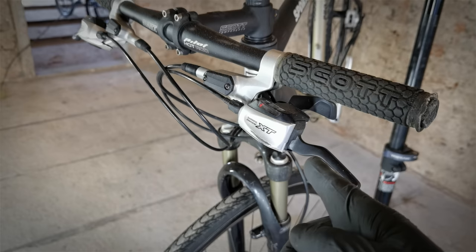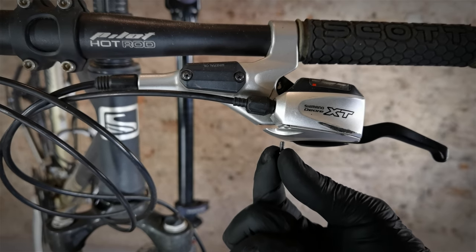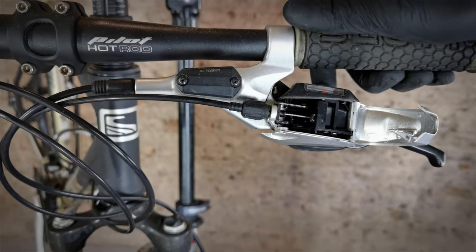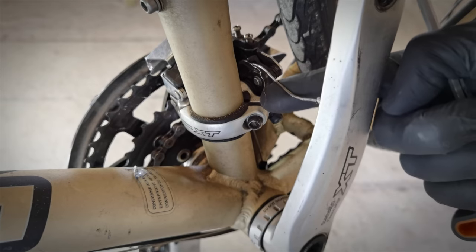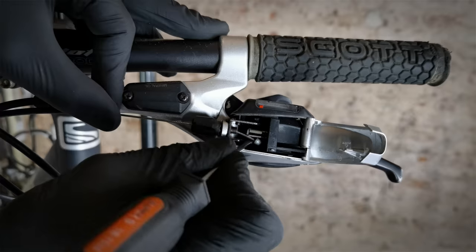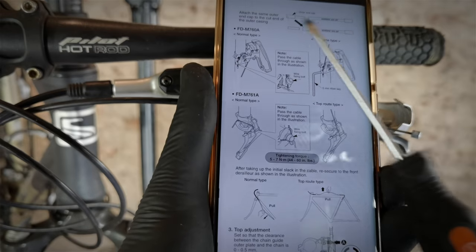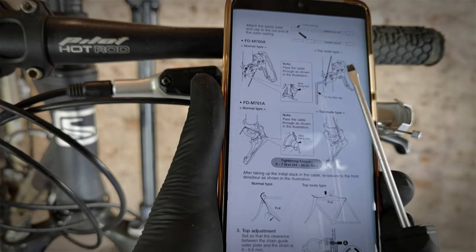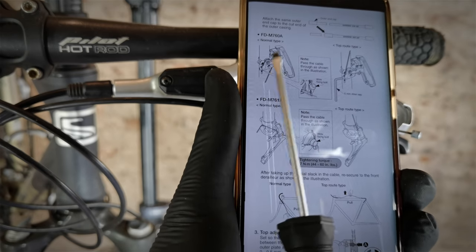This derailleur has the groove on the other side of the bolt compared to the old Tiagra I showed you — you need to pay attention to that. The right shifter had a very obvious cable entry, and this one doesn't have any. Before undoing all the screws, just undo this one right here and the big cap will open up. Of course it has to be shifted down so the cable is not under tension, then undo the fixing bolt — the cable is now free. For front derailleurs, a derailleur can receive the cable from above or below; make sure you route the cable just as it was when your customer brought the bike, but check whether the cable was secured properly.